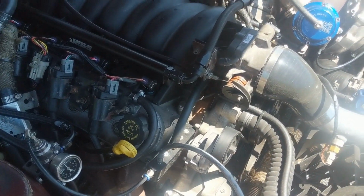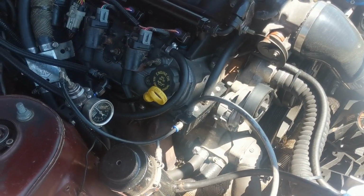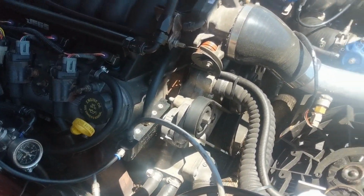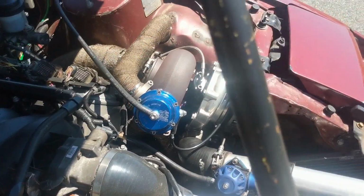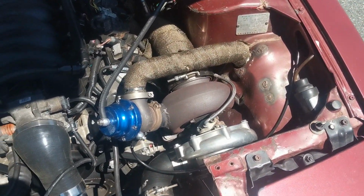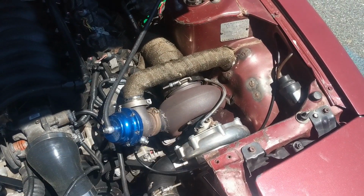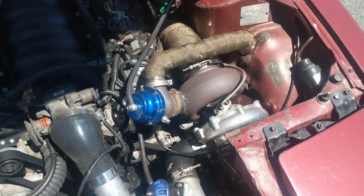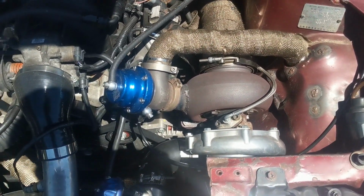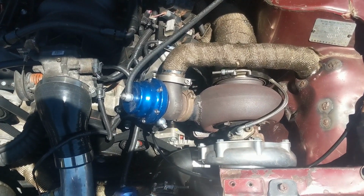The intake is an LS6 intake. It's got the Corvette accessories. It's just the standard flip truck manifolds into a 2 1/4 inch V-band into the crossover. It goes into the turbo. The turbo is actually a Gen 1 billet VS Racing 7875, but it has the Gen 2 housing on it, the bigger housing. The wastegate's just welded right onto the turbine housing. It controls the boost pretty good. It's a 44mm wastegate.